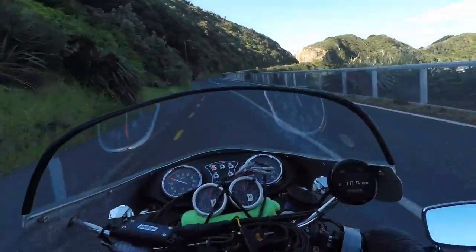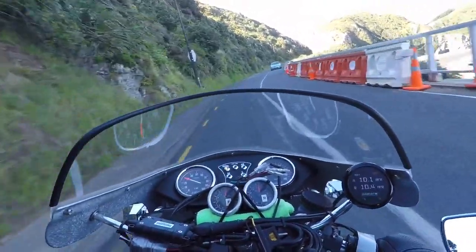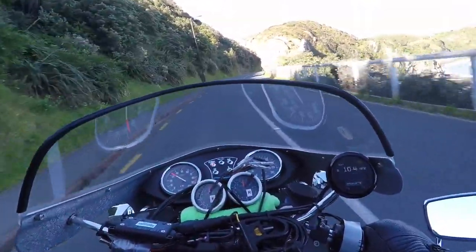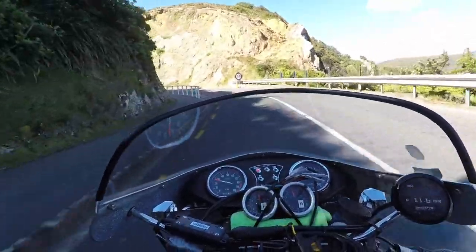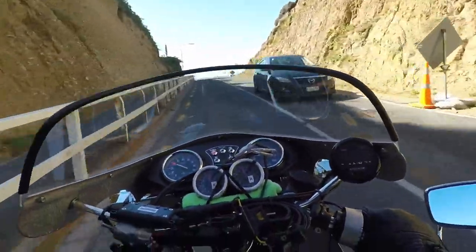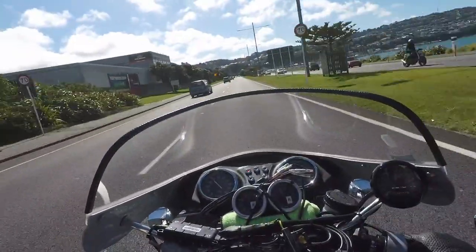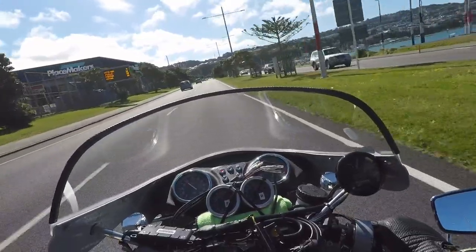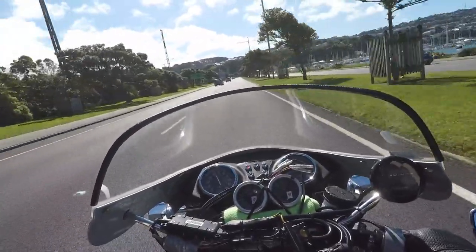Okay, now we can see the meter. It's 10.5 roughly. 10.5. And now the gas and it hesitated. Yeah, I mean it did it. I don't think it was clear on the instrumentation that that was any kind of fault. So here we are, 3800, 80 degrees different in the temperature. Hunting a bit, 10.3, 10.5, gas, A channel goes a bit richer than the other,